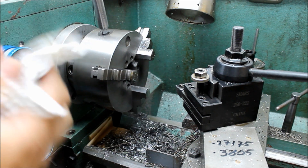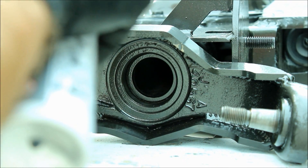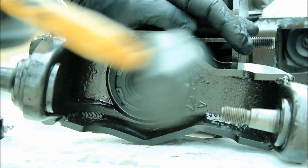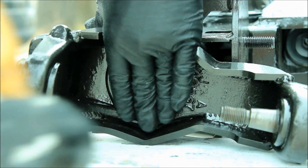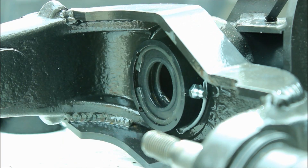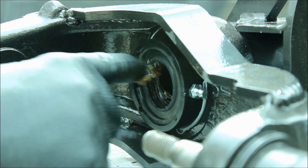I think they're a worthwhile investment and they're really easy to install. I didn't have any confidence that they would stay in with just that little bit of half-inch holding them in, so I decided to essentially glue them in with some Loctite gasket maker. This seemed to work pretty good, and I packed them good and tight with axle grease.